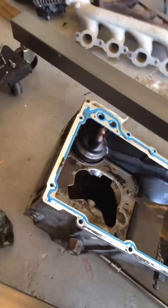So the next step was to remove the oil pan and take a look at the crank, because apparently this is the only one hundred percent sure, definitive answer as to what you've got.